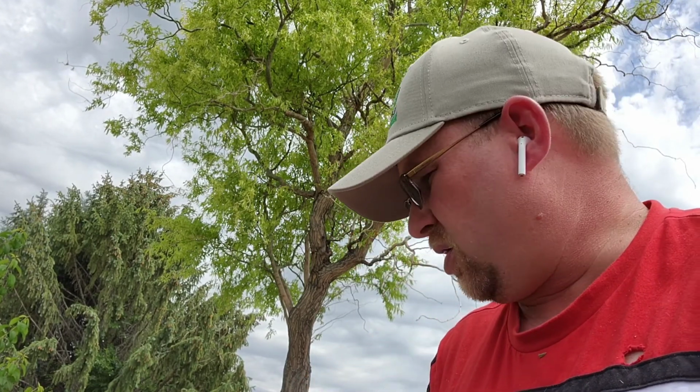Now, I hear a lot about people having trouble with Stihl as far as starting in the heat, and I actually noticed this the other day, and it is kind of a thing. If you don't choke at first, just put it on that second little notch where it's not choking, it just holds the throttle down, and you guys will notice that your trimmers will start right up. But if you choke it, it's going to flood on you, and then you're not going to get it started.